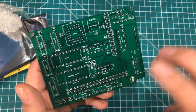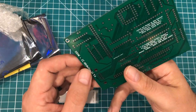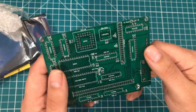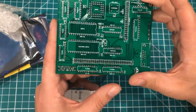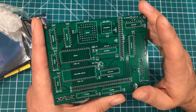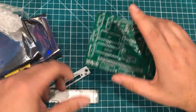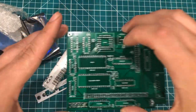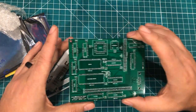The Tandy's did not have a standard ISA slot bus — they had a pin header type bus, and the cards would go down there and stack on top of each other in riser fashion. This one is called the three-in-one because it has a compact flash to IDE adapter, 512K of RAM, and a serial port so you can hook up a standard mouse to the Tandy 1000 EX or HX.